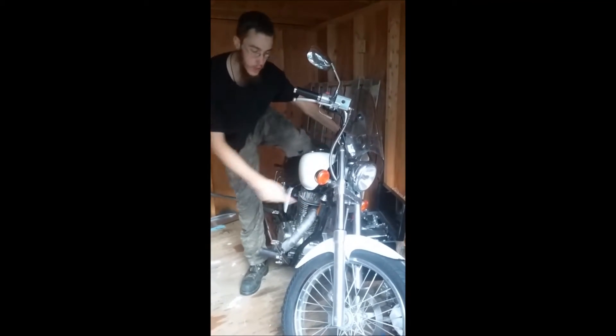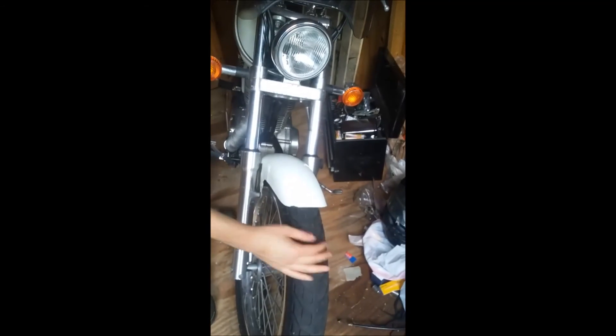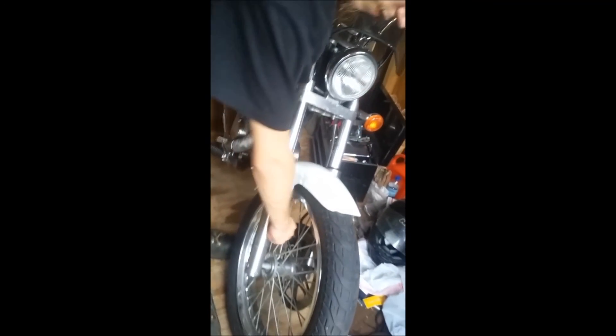The second way is once you press down on this. Now you can see from doing that it's exposed more grease and more oil leaking up. So these are bad, these are going to need to be replaced. We're going to do a video on that once we get the parts in. At the same time, we're going to be replacing the front tire and balancing it, because it's already there and has to be taken out. And we're going to be replacing the front brake pads.